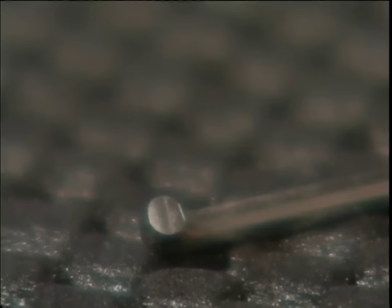This spoke broke at the spoke head, a classic break due to fatigue. This spoke broke due to a one-time overload. This took 2,300 newtons. We can optimize the quality of the wheel we're building by using only double-butted spokes and by tying and soldering the spoke crossings to better stabilize the spoke structure.